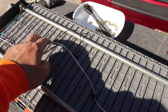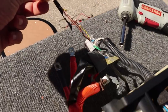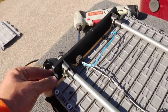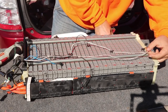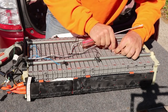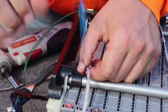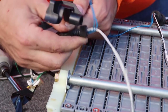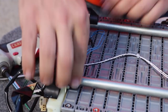I had to do all that to get to these wires, which are just temperature sensors - nothing too fancy - but they all come to that same little wire harness that the current sensor went to. I should be able to just unclip these now. This actually worked out great. All I did was lay the new wire harness right next to the old one, remove the clips - they're just plastic, they pop right off - and then clip the new sensor in right where the old one was. I just did that across the number of clips on the battery pack, very straightforward. The part where the wire harness passes through is actually just a really big plastic clip - it just popped right off - and I could unsnap the existing wire harness from there and pull it out of the way. Then I just snapped the new one in and snapped that whole big black plastic clip right back in place. Couldn't be easier.